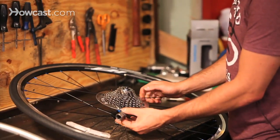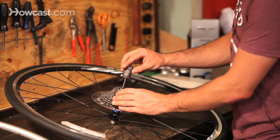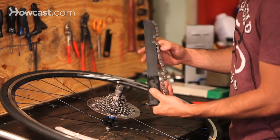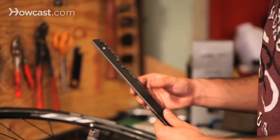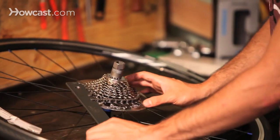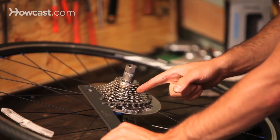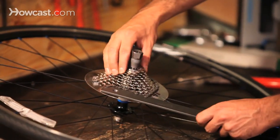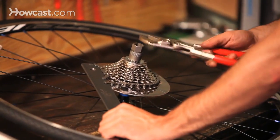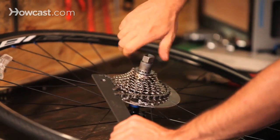Now to take off a cassette, it's a little different and a little harder than a freewheel. You're going to want to use your cassette tool, whichever one works with the spline that you have, and then you're going to want to use a chain whip — there are a couple of different kinds: ones made for single-speed chains, multi-speed chains, things like that. This is a 3/32nd made for multi-speed. Place it usually on a larger cog, and basically you're going to place it so it's pulling the cassette around and making it lock into place where those teeth lock and make that ratcheting sound. Once it's locked into place, your cassette can't go backwards, and you can release your lock ring by going lefty-loosey.